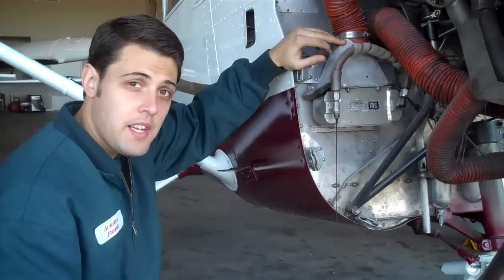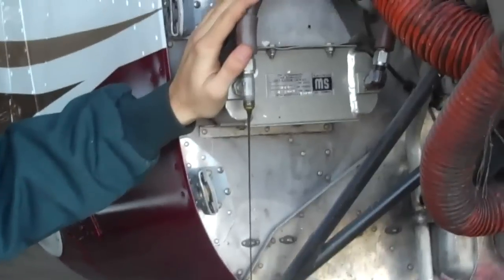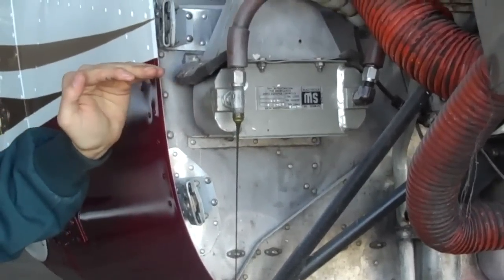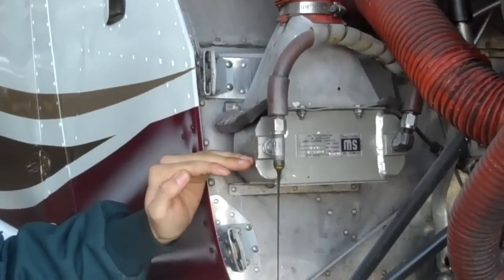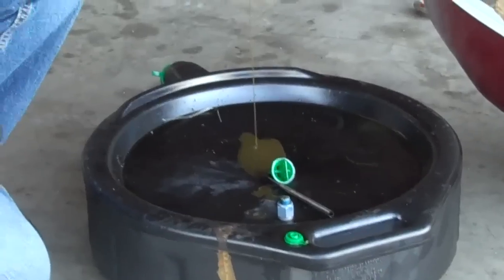Another great tip of advice, while our engine temperatures are still warm, is to go ahead and drain and pull the cap off our oil cooler. That'll also aid in keeping our oil looking fresh much longer. It also prevents the possible contamination of metal that will settle over time in your oil cooler, also leading to a higher oil metal content in your oil analysis possibly over time, and lowering the efficiency of your oil cooler indefinitely.